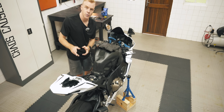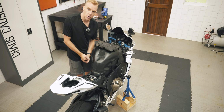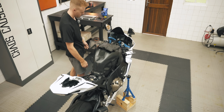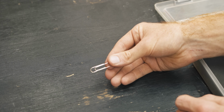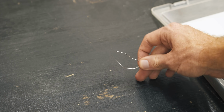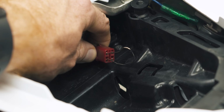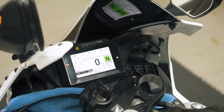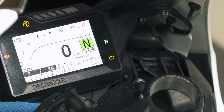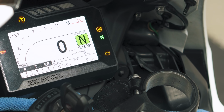Okay, our other issue is even stopping us from recreating a check engine light. I hate Hondas. Nevertheless, here's the process to reset a check engine light. First, you bend Honda's proprietary tool into this shape and shove it into the connector to join the white and green wires. Then you turn the ignition on, and when the engine light flashes, you remove the paperclip and reinsert it into the same pins, which should get the light on the dash flashing again.